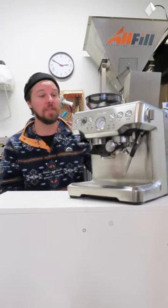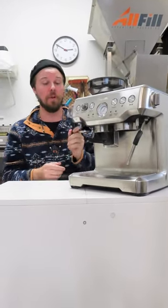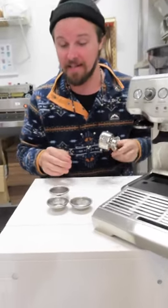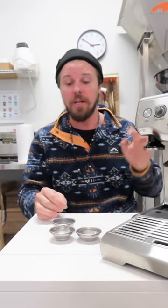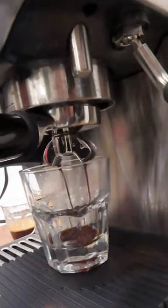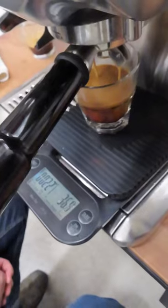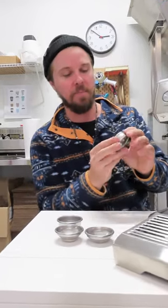What I found particularly interesting about these machines is that they provide several baskets for the portafilter — the main differences being double baskets and single baskets. During testing with the different baskets provided, you'll see on this basket here it's fully perforated on the bottom, more consistent with a cafe-style portafilter basket. However, when I was trying to dial in a shot, I set the grind size as fine as it could go and still found that shots were blasting out of this basket — it wasn't able to retain enough pressure for good extraction.